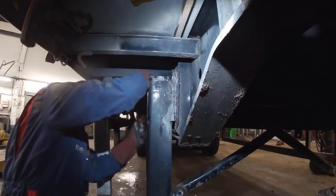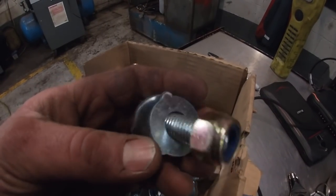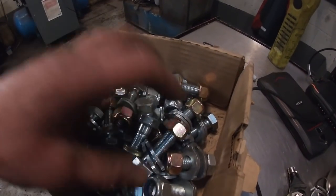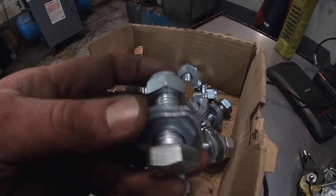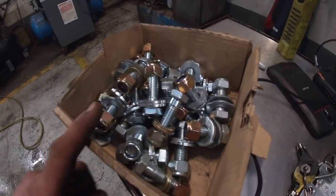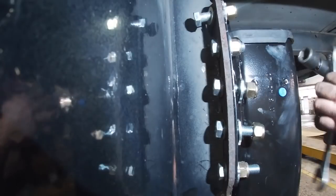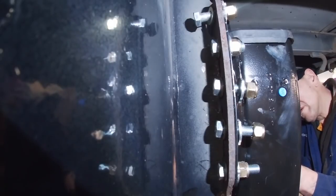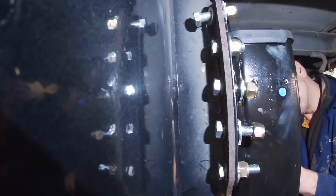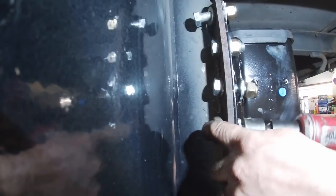Oh look at that, I didn't quite cut that one. So I'll just get the old gas out again, time lapse it, and there we go. Nuts and bolts — M14s, nylocks and special Joss washers, and there are M16s in here for the support brackets as well. It's quite a lot of hardware actually in this box and it is quite expensive, but you can get a kit from Joss to do all that. You should order them every time you do a set of legs if you didn't know. I have the legs down and I square them up and then do them up like a cylinder head first — at diagonals. This pulls the leg up a little bit squarer, because if you do all one side first and then pull up the other side they do sometimes bend the wrong way, so you want to do it evenly.